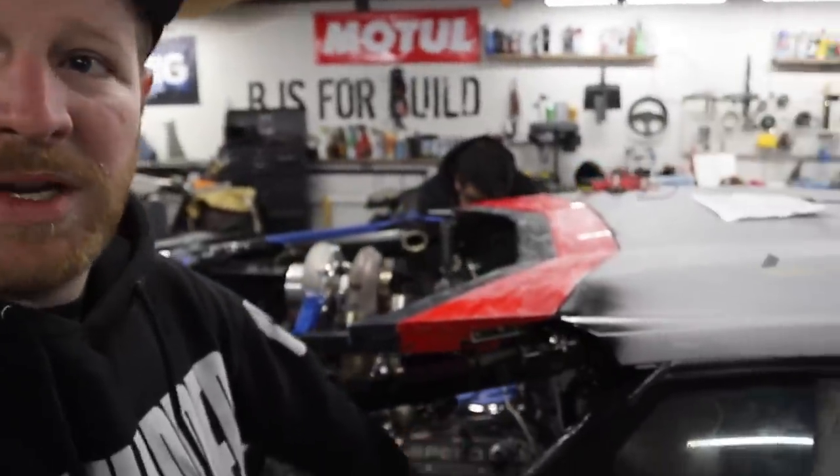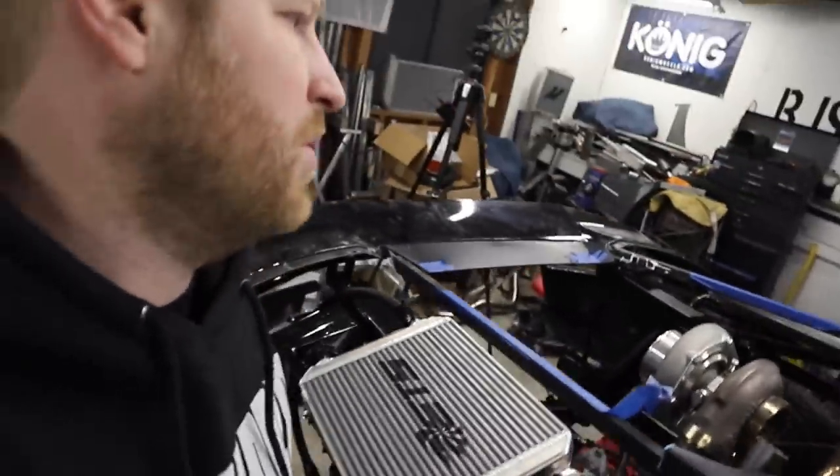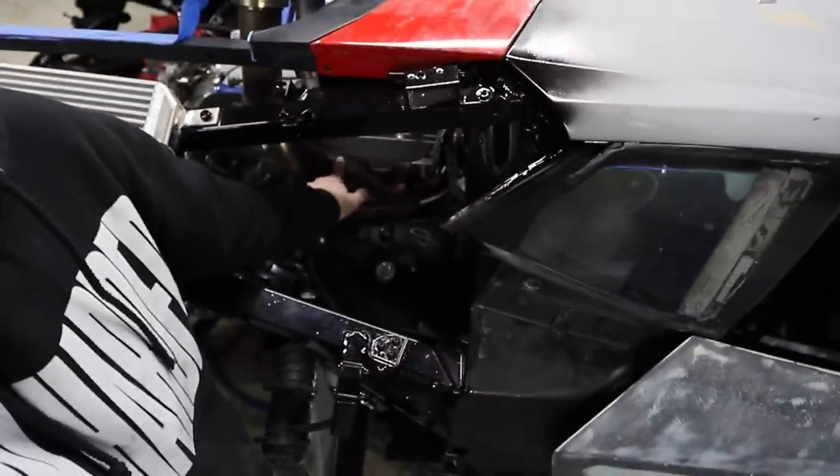The build assembly is going great. We're gonna pull the exhaust manifolds off — hopefully for one of the last times. We might want to heat wrap them off the car, it'd be a lot easier. We got some 3/8 inch stainless steel rod that we're gonna be welding from the flange up the runners to help support the manifolds — we made them out of pretty thin metal. ETS was kind enough to give us all new stainless steel Schedule 40 so we can rebuild these later, but we really want to make sure this thing has a safe drive to SEMA and hopefully on the dyno on the way there.